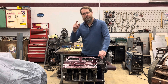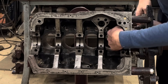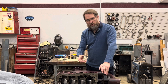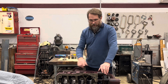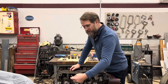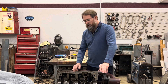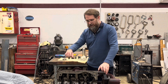One of the easy things to overlook is the lifter bores. Every single motor I ever tear into always has a few lifters that aren't spinning within the bores — they need to spin within the bores while the motor is running in order to not wipe a cam, and that's very common on these things. So what I did is test-fit lifters in every single hole, make sure they slide through nice and easy and aren't snug or going to hang up, and hone them. I did have a few that needed honing; you can just use a small brake cylinder hone for that.